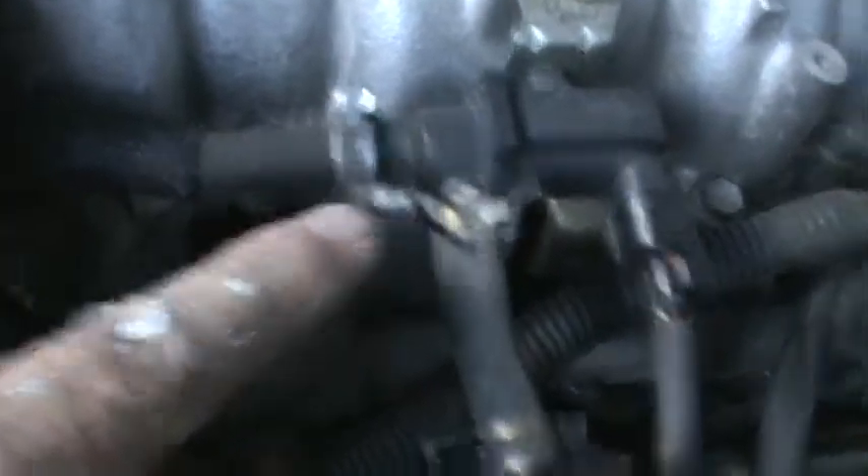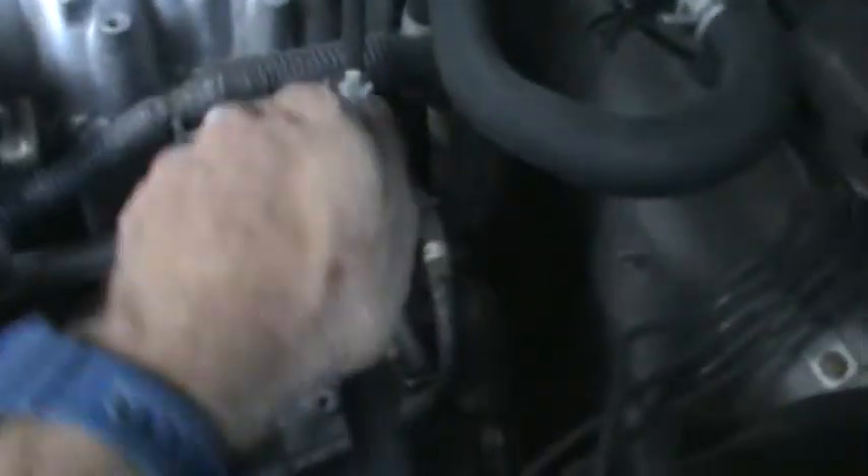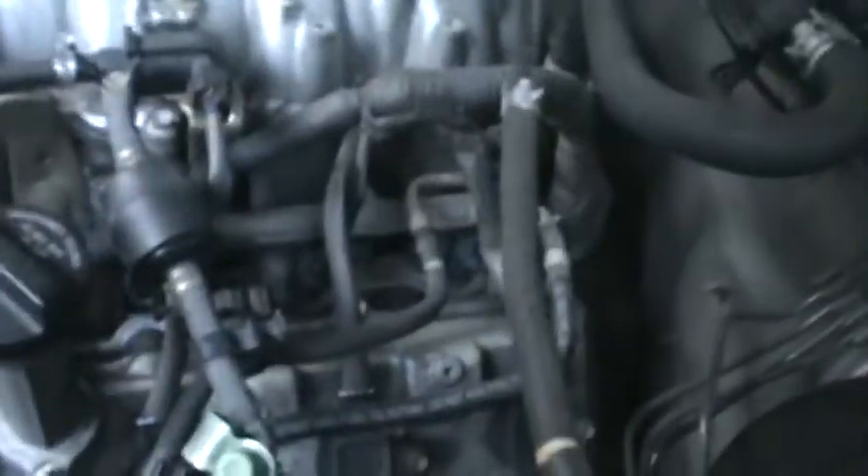What you want to do, Tyson, is look at all the little clamps here and yank on the hoses to make sure all your hose clamps are nice and tight. Because if any of these hoses have a weak clamp, or you can just twist them and they wiggle in your hand, get yourself a hose clamp, do it dirty, and you'll be happy.